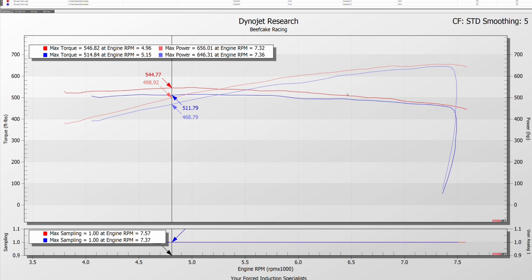If you look at his lower dyno number and compare torque and power difference — on a fifth-gear dyno you see 494 foot-pounds of torque, but in sixth gear you see 524 foot-pounds. That's 30 foot-pounds higher. At the peak, you've got 546 versus 514 — again, about 30 foot-pounds. The reason they originally dynoed in fifth gear is that the factory speed limiter prevents a full pull in sixth gear or above on these cars.